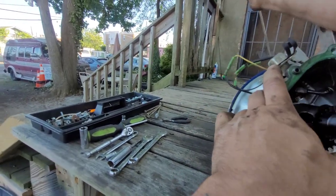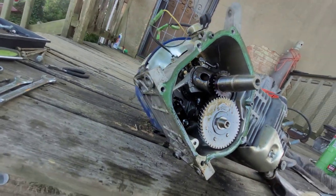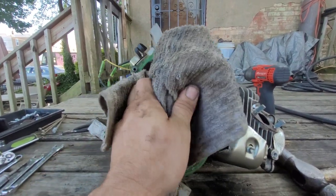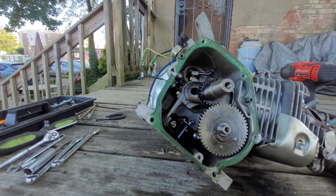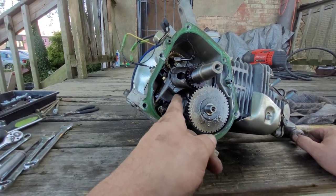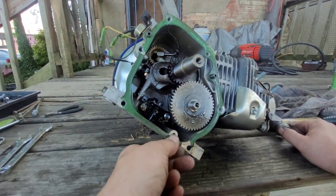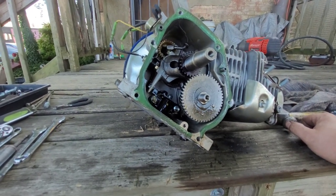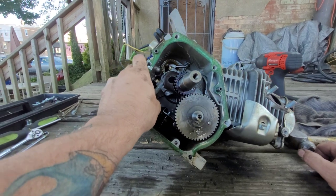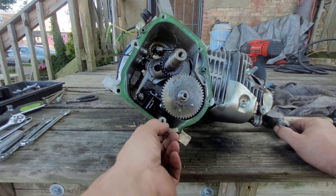Side cover or pull start needs some work. Looks like about a stroke, looks pretty short. Wonder if it's a 54 or not. I'm not sure, but like I said, anyhow, I'm gonna swap the crank. We'll do a governor delete and put a new side cover on, and we'll have a decent little motor. I have billet rods, I got a couple motors with billet rods, but they're going to stay in them motors. This will probably just be going on a flip bike or something. Don't know.